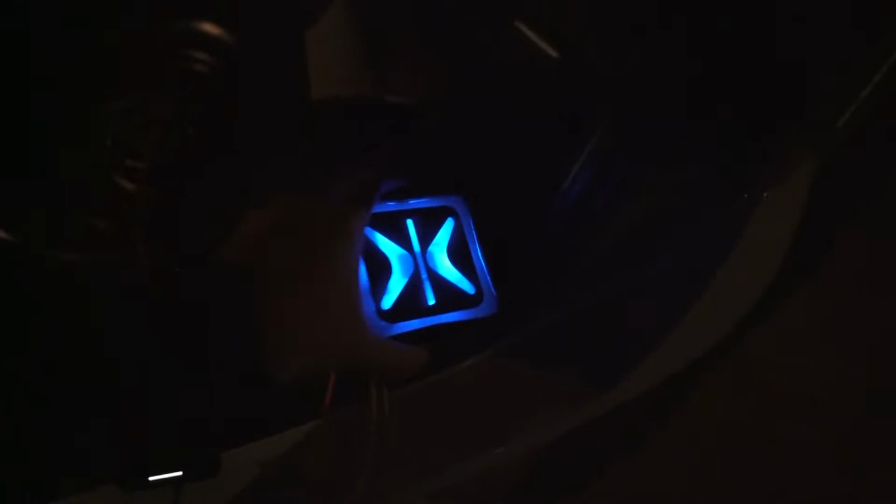Okay, so it's gotten dark outside now. It's only 6. It's the only thing I hate about this time of year. We ran some of the wiring. I just wanted to see if I can get this to power on, and I got it to power on. The coolest thing is this is RGB backlit, so it will light up as the focal point in the trunk. Right now it's running software updates. All I did is hook up the positive wire to this fuse distributor box, and the negative to it, and then this orange cable connects to the ignition fuse. It wouldn't turn on, and then he found the ignition fuse in the engine bay, so we hooked that up and it turned right on. So I'm letting it run an update and then I'm gonna see how this whole thing works.